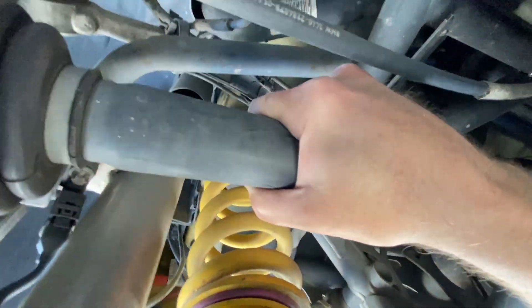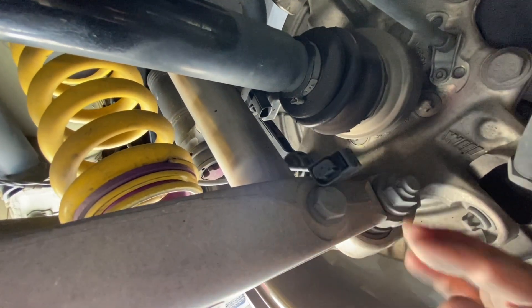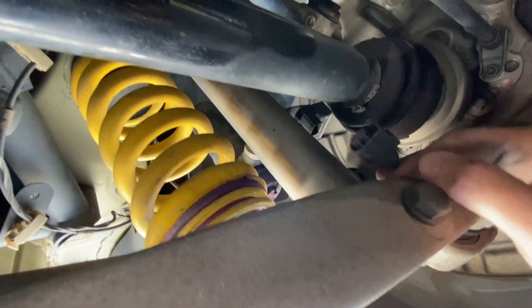It's very hard to pull that one back and forth, whereas on the left side it seems really loose and easy. While I'm down here — look — there is a cable that is completely disconnected, and I think that might actually be the speed sensor. This is one of the other sensors that's down here, but I'm pretty sure that should be plugged in. Let me put this back in.